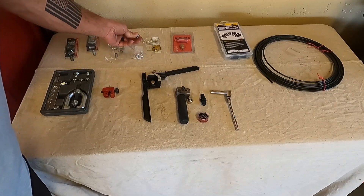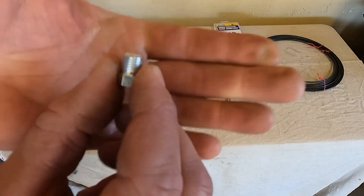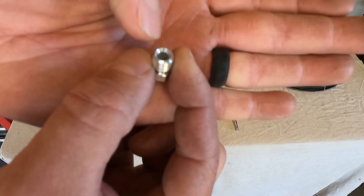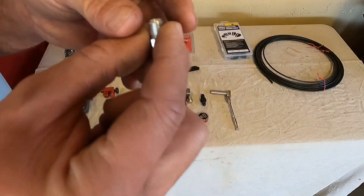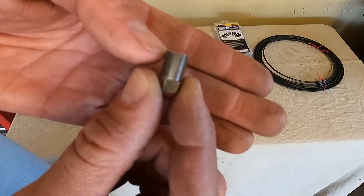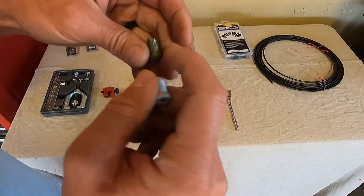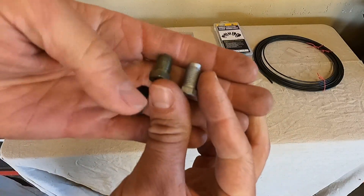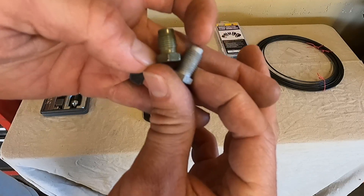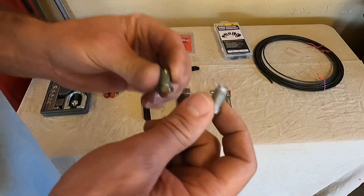Here are some examples of the different types of fittings. This is an SAE threaded fitting for a double flare, and you can see that the threading goes all the way up to the top of this tube nut and then it's tapered in for that double flare to rest. This is the same thing except in metric thread pitch — you can just see that the threads go all the way to the top. These last two are the same thread pitches in SAE and metric, but the threads don't go all the way to the top. There's a long shoulder on the top edge of both of these tube nuts and they're inverted — these are examples of bubble flare tube nuts.